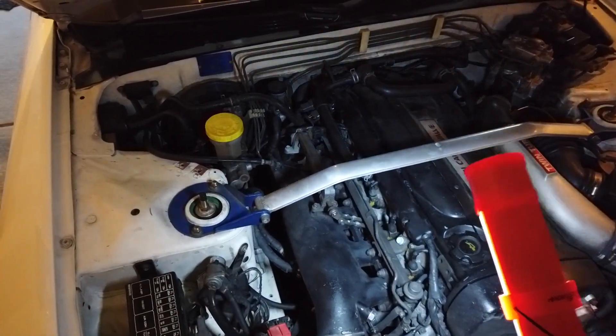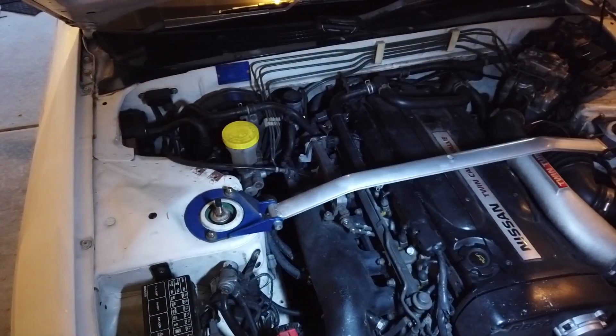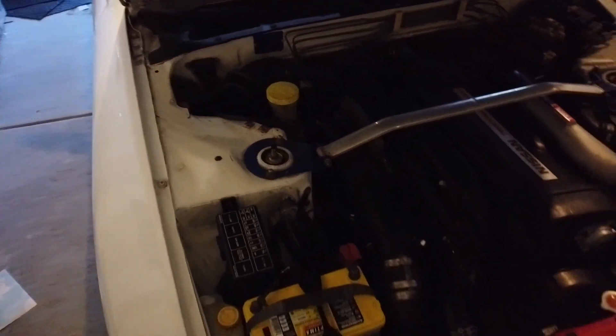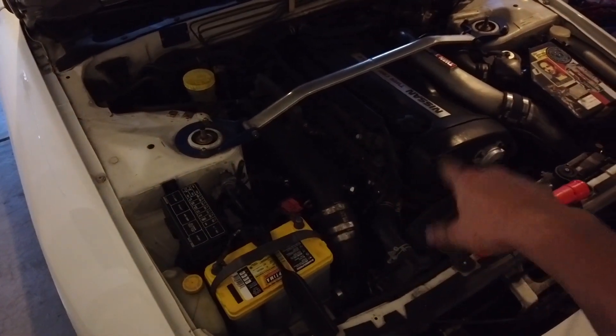This whole intake manifold has to come off so I can reseal it, and that should solve the slight hesitation and the stalling when hot. Looks like I just have an intake manifold leak from the head to the throttle body — it looks like cylinder 5, but I'm just going to do every gasket in the manifold. I got the Tomei metal gasket kit. It's a pretty common issue on GTRs. Thanks for watching and see you next time.